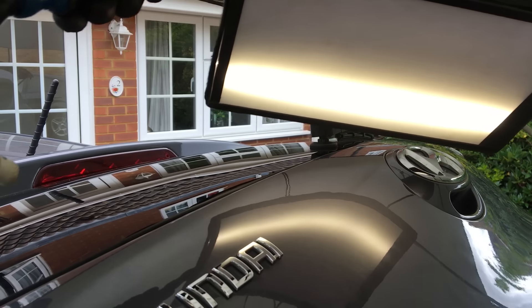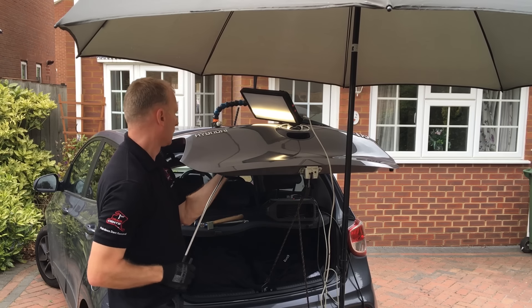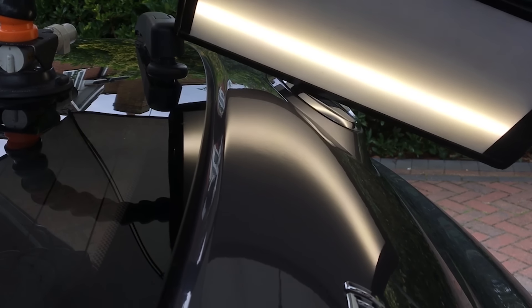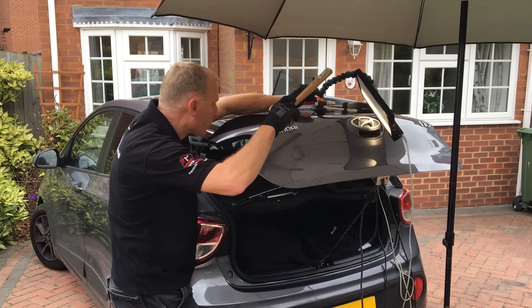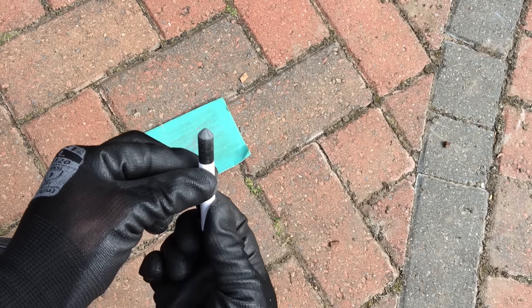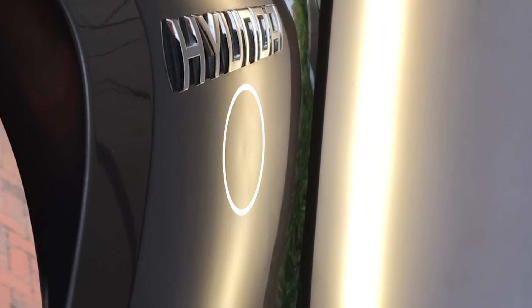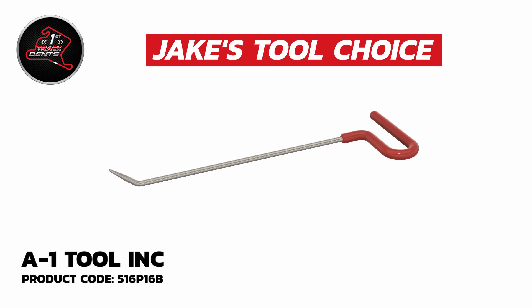I'm happy with the blending process so far — now it's time to get on with the fine tuning. This is the stage where the tools become sharper as we only have the little micro lows to lift up. This is probably the longest time spent on the repair because it is a painstaking task which needs a huge amount of accuracy and patience. You don't just have to be accurate with your pushes — you also have to be very accurate with your tapping down too. Because I'm working on such fine detail, I always like to make sure my tap down is as sharp as a pin, so I sharpen it using some very fine paper. Just as I thought I'd finished, I spotted a small penny-sized dent just below the badge, which was easily removed using one of my small bars from A1 Tools. I'll link this tool in the description.